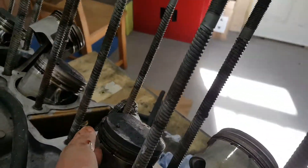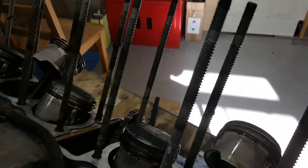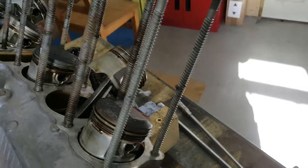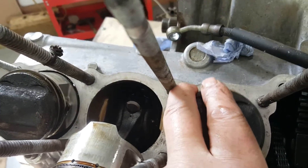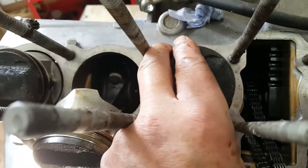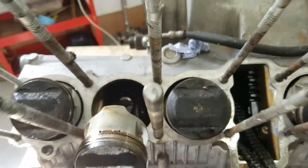So that's the barrels removed now. I thought this was a pretty low mileage engine, and we can see here there's been very little blow-by past the pistons, so we'll do an inspection within service limits and see where those rings are. They've either recently been changed or this is a low mileage motor. The main reason for pulling this apart is there is a slight bit of movement in the number four cylinder on the bottom end, so we're going to split the motor and inspect that. Hopefully it's just a new bearing and we should be good to go.